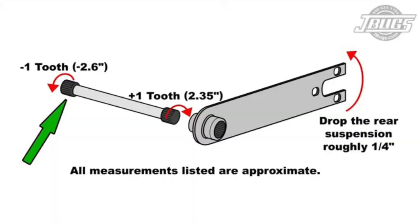Compared to the front, the rears were actually honestly a lot easier, because everything kind of just went in the way it should have. The next video is going to be me running the actual lines from there to the compressor — running all the airlines and electric lines — but that's going to be for the next video. I'm going to put up a picture right here so you guys can see how the splines work, because if you rotate it from the inside it lowers it a different amount than if you lowered it from the outside. You guys can use that chart to dial in your setup. I should have about 7 to 8 inches of travel now, so the car should be able to raise up and lower back down pretty evenly.